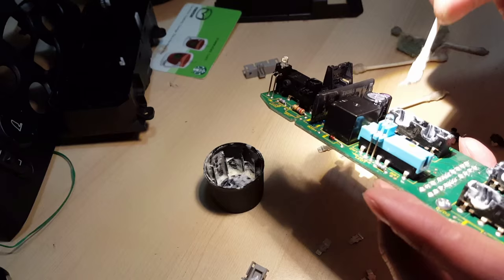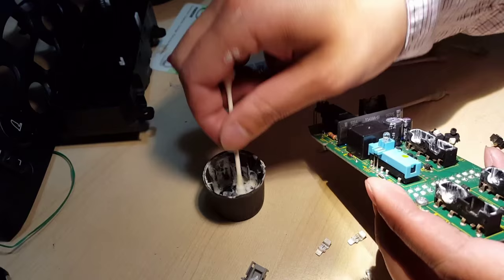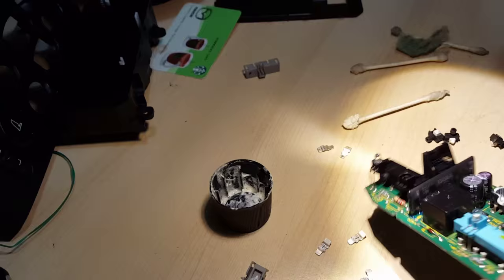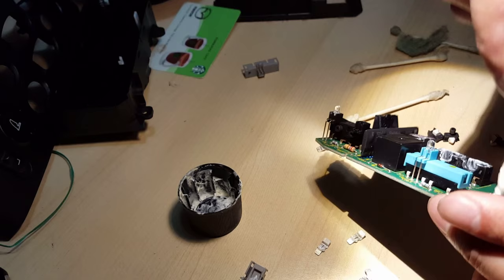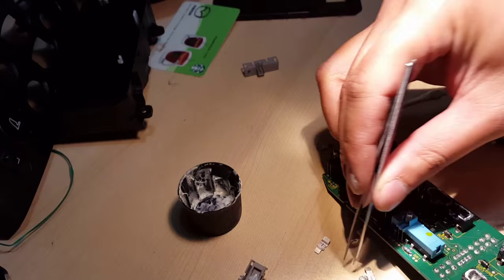I'm starting to think that it's probably either rain or maybe water moisture got caught in the switches with the windows open, or the air conditioning might have sucked in air through the switches. If you ever put your hand over it, it sucks in air. That might have caught dust in it or water moisture, so it's causing the contacts to corrode. Anyways, we lather it with a little bit of white lithium grease